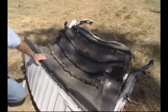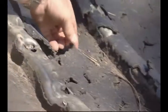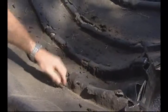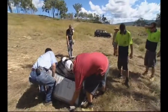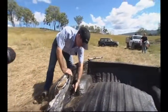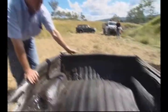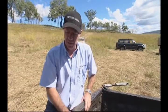You can see here on the cargo bed the amount of damage that has been done via shrapnel. The interesting thing is, even though it's badly damaged the liner on the underside, you can see how much shrapnel has been taken in by the liner. But if we remember back to the last blast where we had an unlined one, that shrapnel just punctured straight through the bottom of the floor. You can see the cargo bed is still intact. We don't have any splits around the wheel arches, no splits in the front corners, no splits on the rear corners, and there's no punctures on the floor. Although it's badly distorted, no shrapnel has come through that floor. We've basically got a complete cargo bed with a bend in the middle. I think this is a pretty good result.